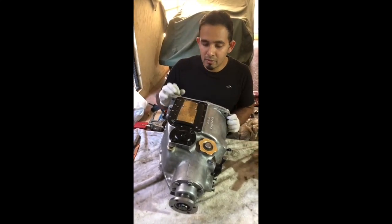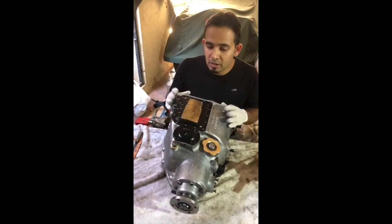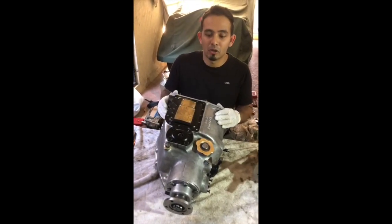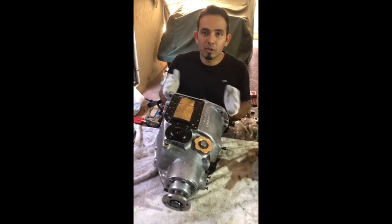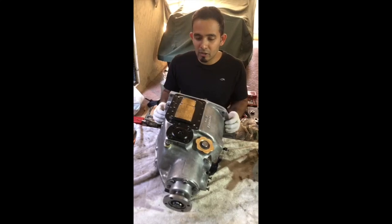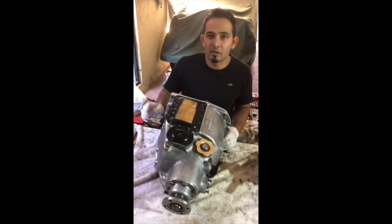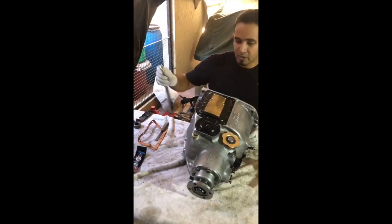Just finished the assembly of this Daimler pre-selected gearbox and I'm going to show you how it works internally and explain how it's different from other gearboxes. Basically this gearbox was an in-between state between automatic and manual gearboxes. The idea was that they didn't want you to keep pressing the clutch, which can get pretty hard especially in city traffic, so it sort of eliminates the clutch.